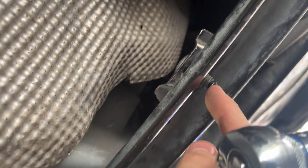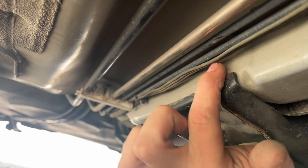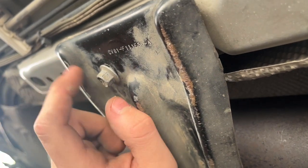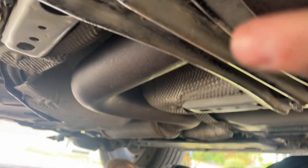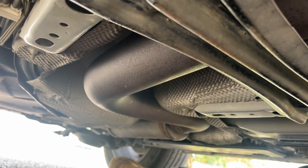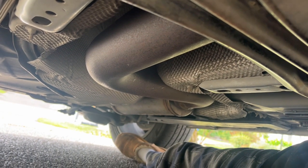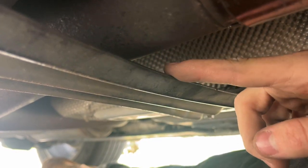I'm missing one bolt and I don't know where it went, so it's not going back on. You're going to want this piece oriented so it curves over facing upwards, with the rear facing the rear of the car. I've got the brace on so the exhaust is sitting right on it — it would rattle a lot, but once the back section and the tip section are in their rubber pieces to hold it up, it should sit higher and I won't get much rattling.